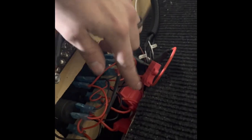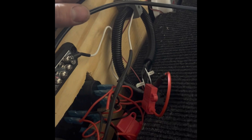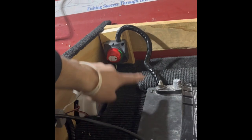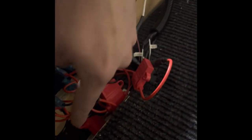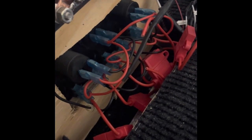The great thing about this switch panel is it has inline fuses — 20-amp fuses on each one of these — so I'm well above where I need to be but still in line with most common accessories. So the system is: power from your battery to your switch, the power line goes into the end of the switch panel, and your ground goes into the panel — all in line. You're all grounded and safe on that side, and everything's fused. Then you take your power from your switch to your component and your ground to your bus bar. This allows you to dedicate your grounds all to these terminals. That's why it's great to have a bus bar.